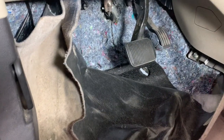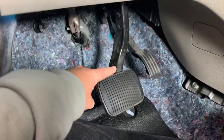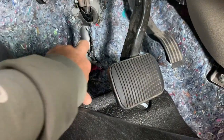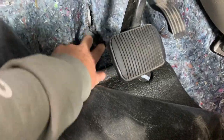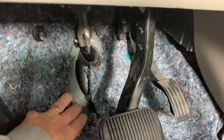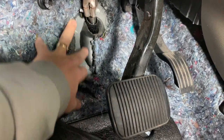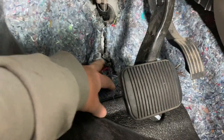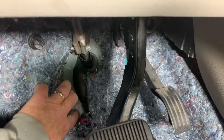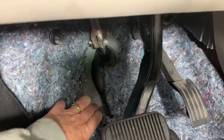To begin with, I pulled back the carpet on the driver's side to get a reference point of where I wanted to hook up. The Ready Brake should connect in here, so ideally if I can get access directly below it, I'll do that. I've got the carpet pulled back and cut back the underlayment. Trying to get a reference point — where the steering gear goes through is a good reference point. I'm going to be just a little bit below and to the left, around below this pinch weld here, where I'll try my pilot hole.